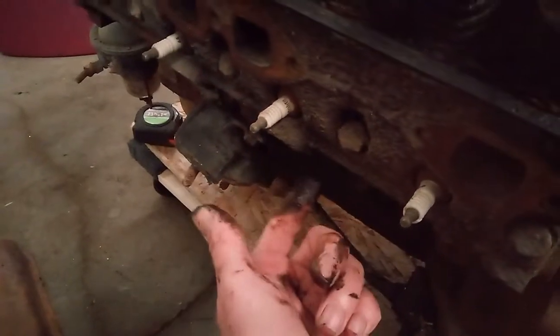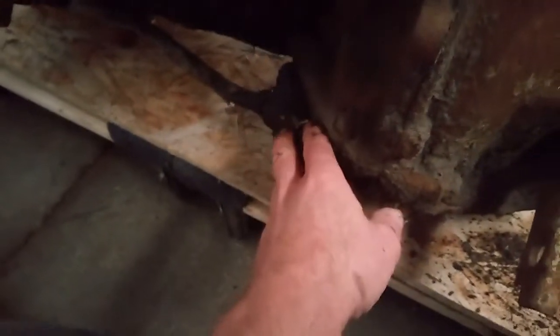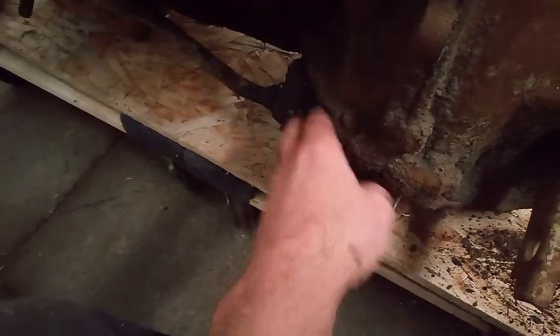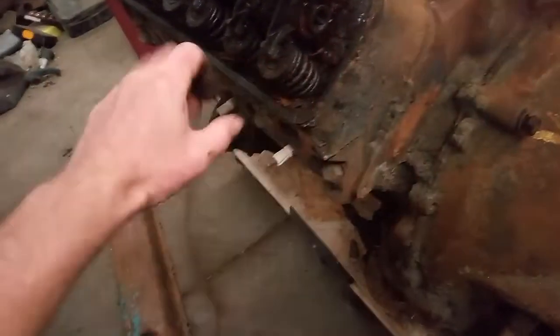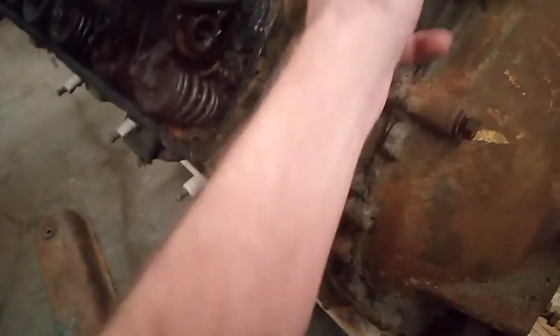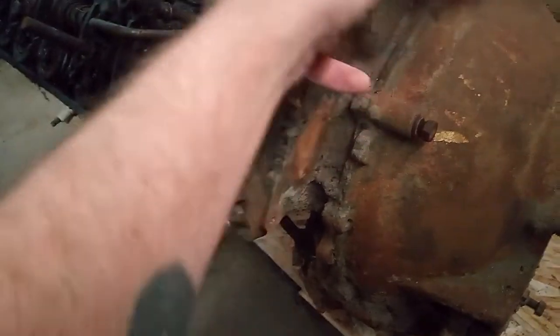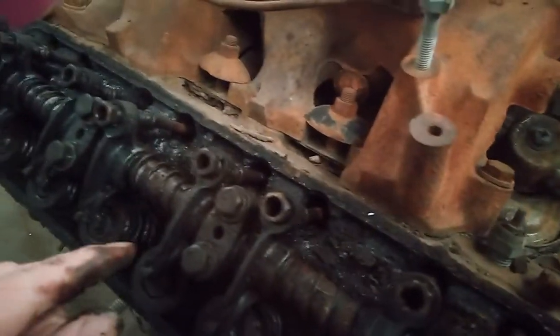Your oil comes up from the camshaft, the crankshaft, from the oil pump here. From your oil pump, it pumps the oil from the pickup tube through here, goes through these oil galleys. You can't hardly see them there, it's dark. But anyway, there's oil galleys, holes, like built-in pipes all over in the block. It goes around, it oils the crank, and then comes up and oils the camshaft. And then there's 2 galleys that shoot the oil up through, I believe it's this one.